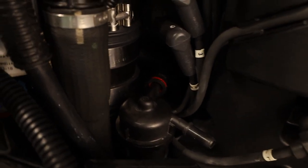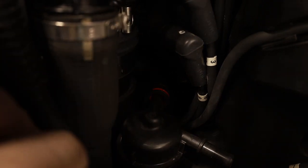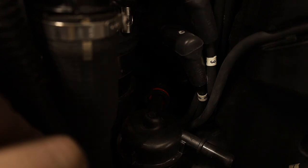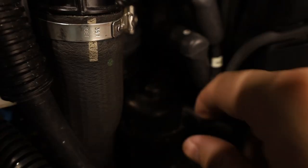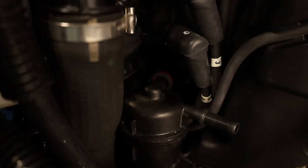I know it's probably difficult to see, so I'm going to move the camera. That's why it's not coming out — you've got to rotate it. Rotate it and then it pulls out. Now I have a little more room to work with. To get the filter out of the housing, you rotate it clockwise looking from the top, and then the housing comes free.